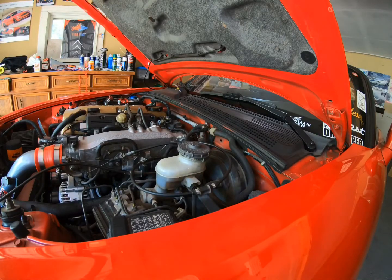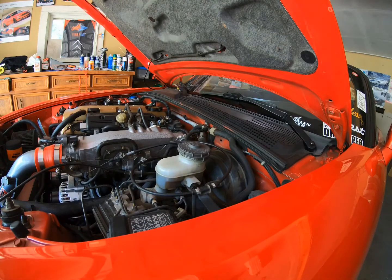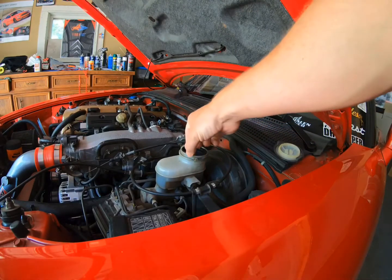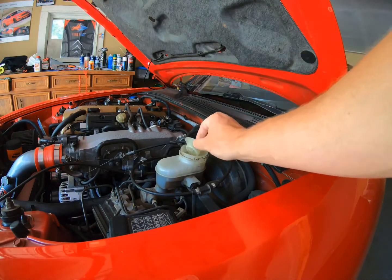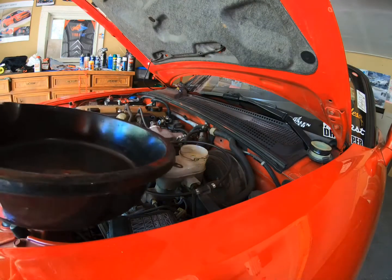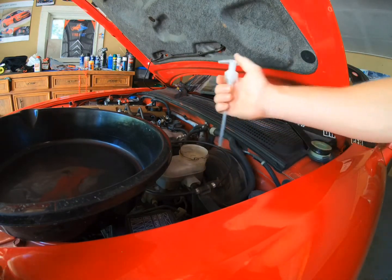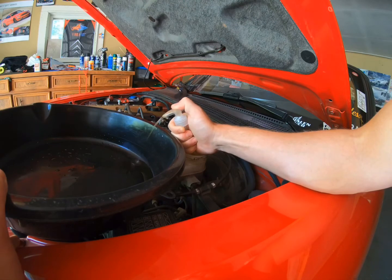All right guys, time to actually get started. I'm gonna try to give you the quickest rundown. First I went around and cracked loose all four lug nuts, and from there I'm going to take off the brake fluid reservoir cap. Let's pull this plastic piece out. From there we can see all the old fluid. I've seen people use a turkey baster to suck out all the fluid. I don't have one available, but what I do have is an old pump from shampoo — so I'm gonna stick it in here and this is how I'm going to attempt to get it all out. It's actually working really well.